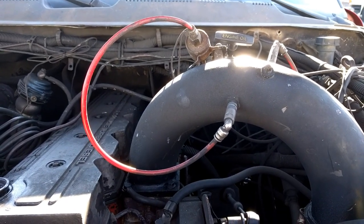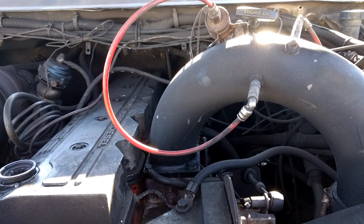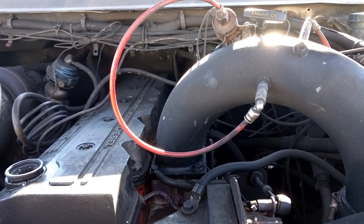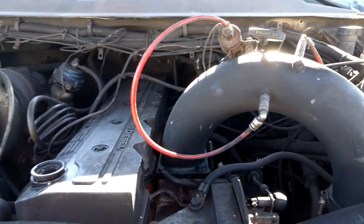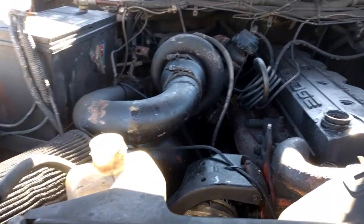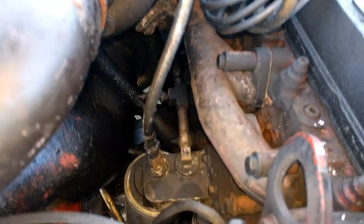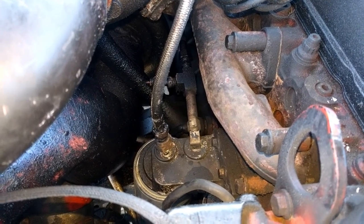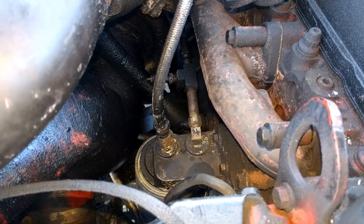If you're getting oil from somewhere you didn't put in there, you know it's coming from somewhere. I've heard people say leaky injectors can also add to it, but I don't necessarily buy into that because the injector doesn't dump out fuel when it's off, and when it's on it's burning fuel. When an injector goes bad, it burns a hole in your piston — it doesn't dump fuel in your oil. The amount of fuel it would take to dilute all that oil would be quite a bit. One other thing you can look for is oil in your radiator overflow tank. There is an oil cooler bolted on your oil filter that has been known to leak occasionally — not very common, but it can leak and the oil will mix with your antifreeze, or vice versa.